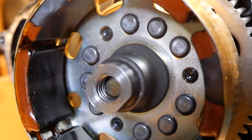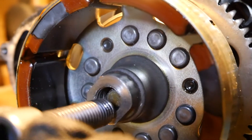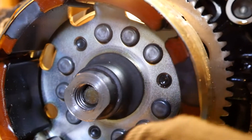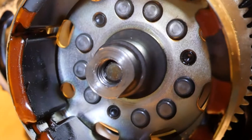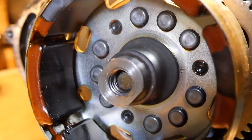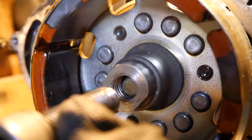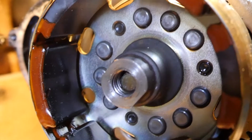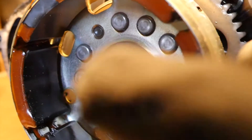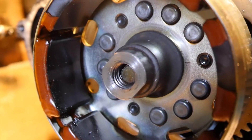In line with the Haynes manual suggestion, I've got a big bolt which threads into there. And I've poked into there a 36mm long bolt — it's just acting as a spacer to push against the crankshaft. Hopefully when you screw this bolt in, the act of screwing that in will press against the spacer, effectively onto the crankshaft, and we'll pull this way. That is the theory — let's see if we can put it into practice.